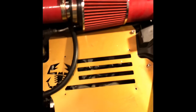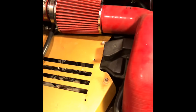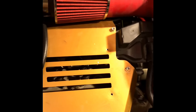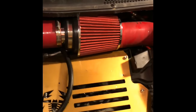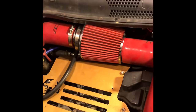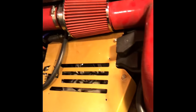I got the NGK spark plugs, which I'll probably switch back to Brisk because I did run Brisk for a while. Since it's a daily driver, NGK is what I went with just because you don't have to replace them as frequently. On Phase 3 you're supposed to replace the spark plugs after every other oil change and supposed to clean the filter every oil change. Yeah, I got lazy and haven't put my Euro Compulsion filter back on yet.